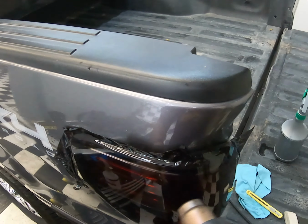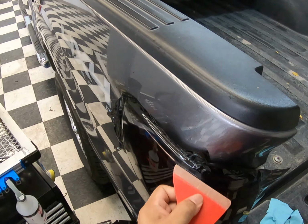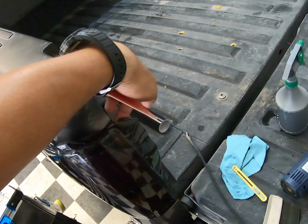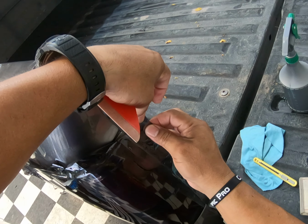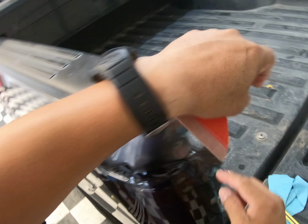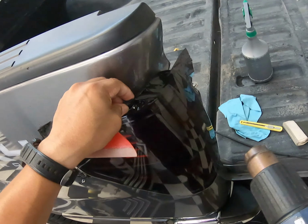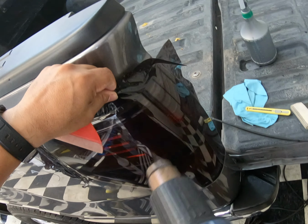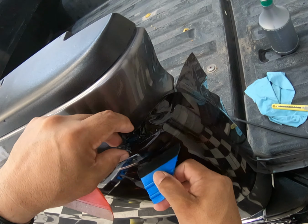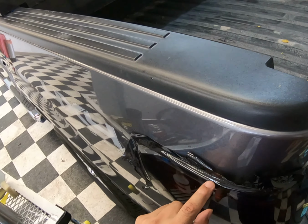When we add too much heat and then we try to bust it in there, it really is elongating like this. Watch. What the film is really doing is elongating like that, and then coming back, elongating and coming back. And those little kinks are what's going to stay in there. You really don't want that. You just want to get a temperature that will make it start being gooey, like right there. It's perfect. And then just very slowly roll it in there where it belongs, and it's going to stay like that. So this is what I'm talking about, a perfect ledge.